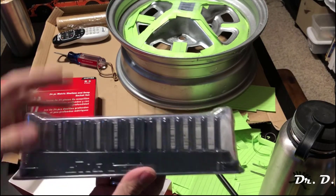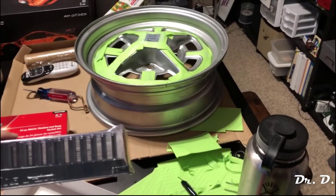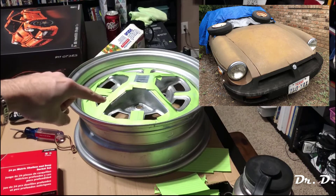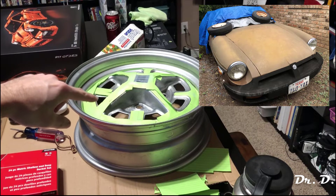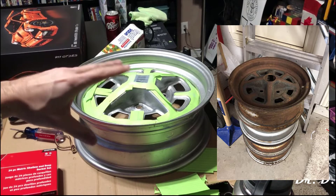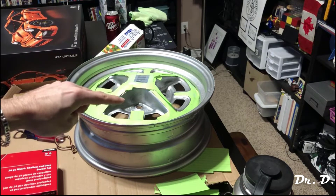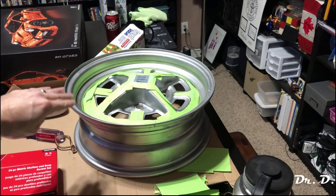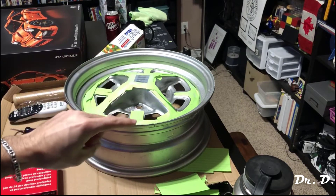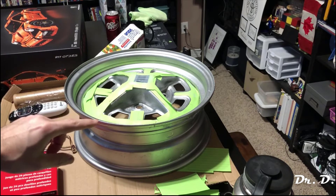Over there I'm masking off a wheel for the MG project I'm working on. Remember, this wheel was completely covered with rust. I spent a lot of time de-rusting it — I had to soak the wheel in WD-40 rust soak for about 48 hours, then basically grind off the extra rust and get it all smooth, then base primer it with a rust-converting primer.